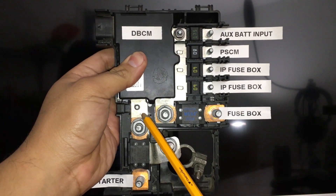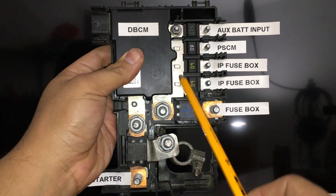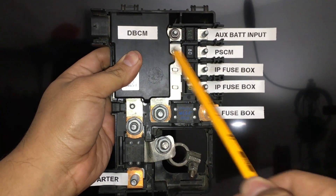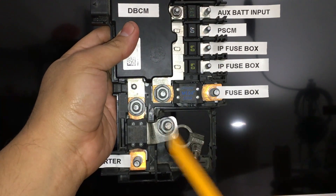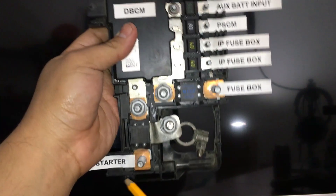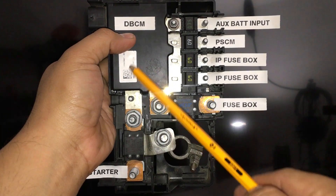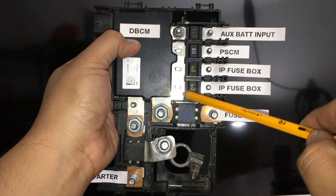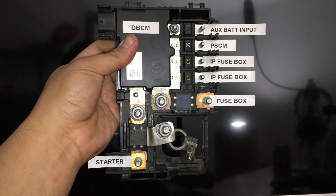Following the strip down, there's a 200 amp mega fuse, and at that terminal there's a large cable attached that goes directly to the under-hood fuse box, which houses everything from the starter relays to the ignition main relays. So in overview: two battery power inputs — the primary battery feed and the auxiliary battery power feed — and over here the accessory loads. The dual battery control module switches these accessory loads over to the auxiliary battery during cranking, allowing the primary battery to focus all its current on turning the starter motor.